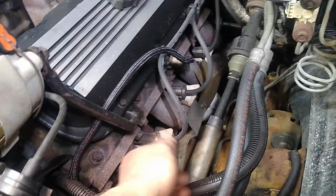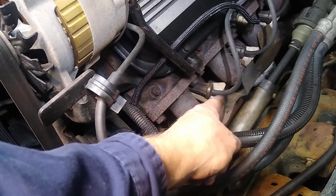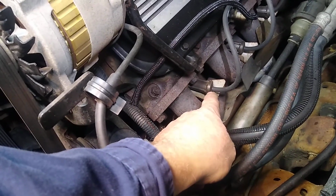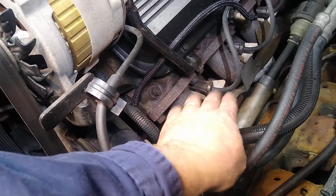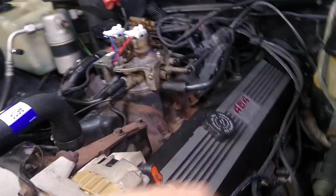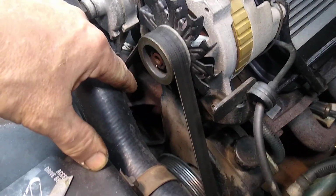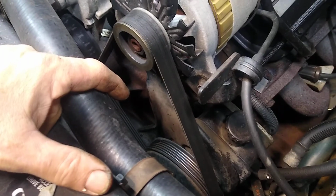That is when you have a bar on the engine and are turning the engine by hand, or if you had someone actually here to crank the engine for you, feeling pressure or air dispel from that cylinder when the spark plug's out. So finding top dead center on that cylinder, setting the distributor in, and getting the timing set, which took a little bit of doing.